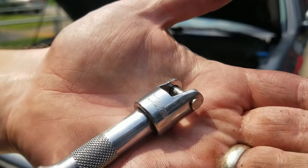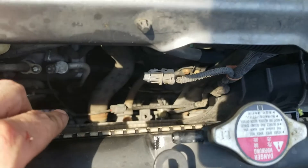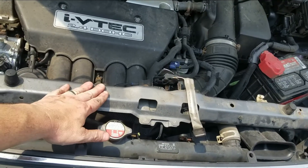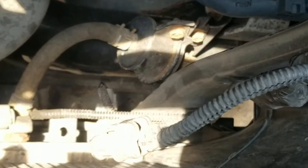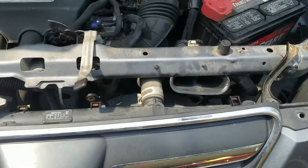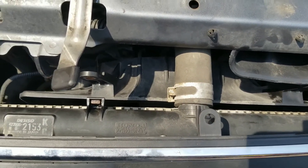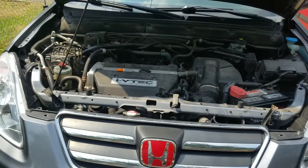I'm having a really difficult time getting this radiator fan out. Since I can reach down there, I'm going to remove the center t-bracket bolt — it's right there on the front side — so I can move it around better. That big round cylinder is right in the way of getting to the bottom bolt on the t-bar. I don't want to remove the radiator hose, but it looks like I might have to. It's literally 100 degrees outside.